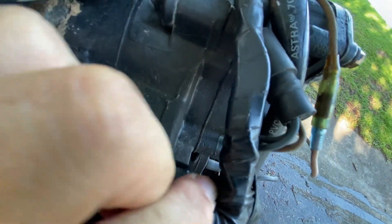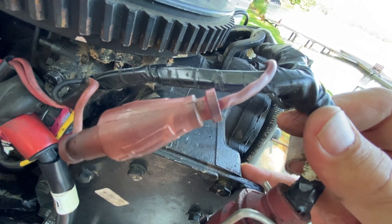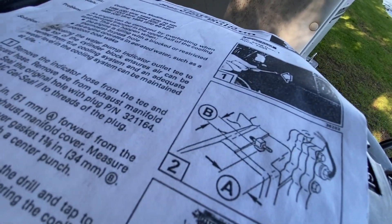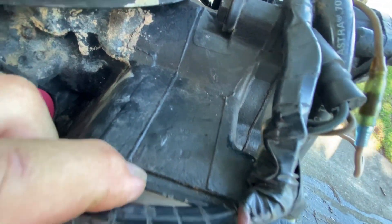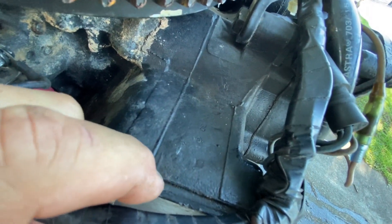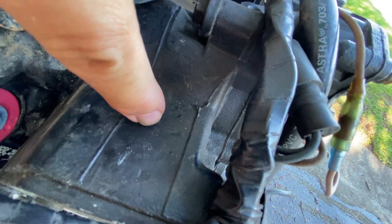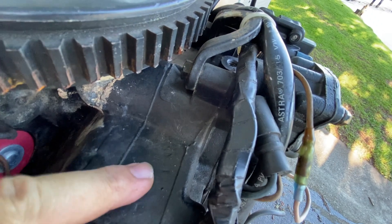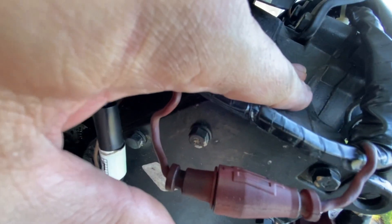They want you to come in from this outer edge right here — this is the water jacket, the exhaust manifold. There are some wires in the way, but at this outer corner spot, they want you to come back two inches and mark it, then from this gasket right here come in one and three-eighths inches, drill a hole, put the new T right there, and that will allow any air to escape.